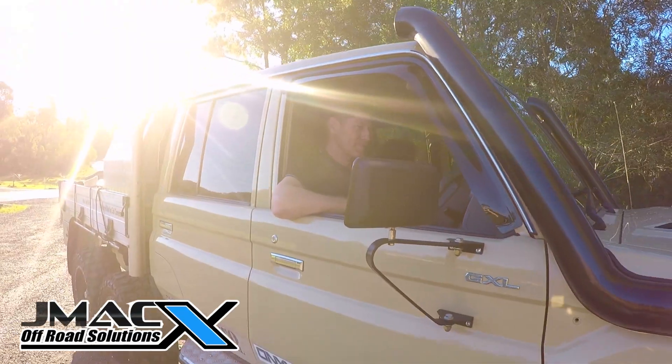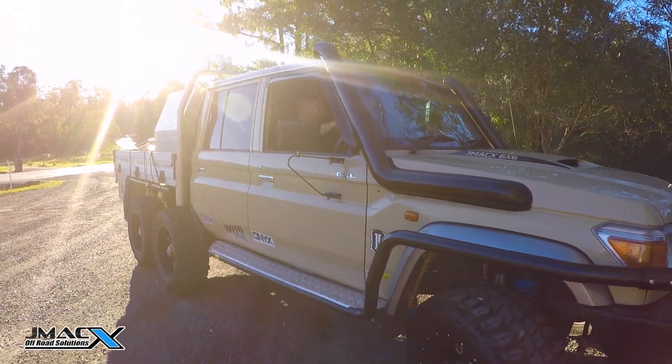We've fitted a brake booster — nothing else — and what we managed to do is lock up those 35-inch tires. Six wheels, not four — not much of a road surface there. We left two black lines about 20 meters long at 90 km/h, full lock-up. This thing weighs about 3.4 tonnes, so that gives you a bit of an idea — there you go.